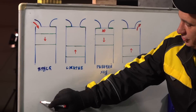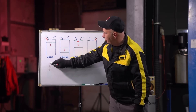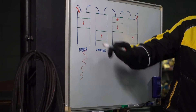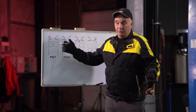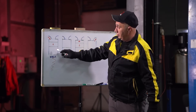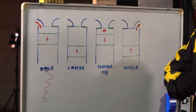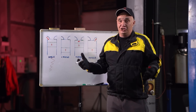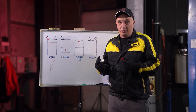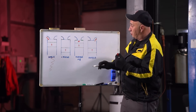The theory behind all of this is pretty interesting. During the intake stroke, we have the piston at TDC, and the spring is stretched out as the piston makes its way down. At this time, the spring is transferring its energy to the piston and facilitating its descent. So during the intake stroke, the vacuum is going to develop more rapidly, filling the cylinder with more mixture that is then going to be burned. And that's already a great benefit.